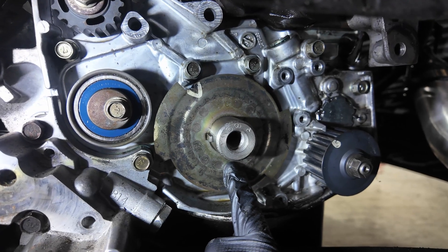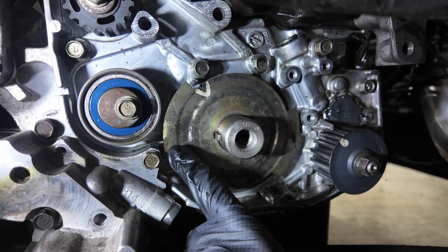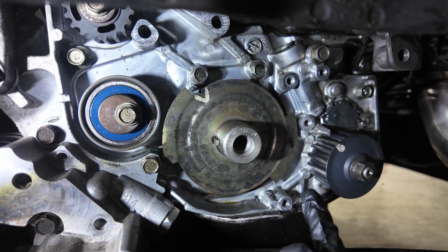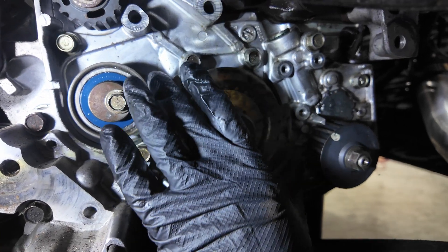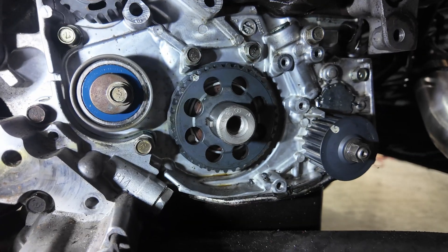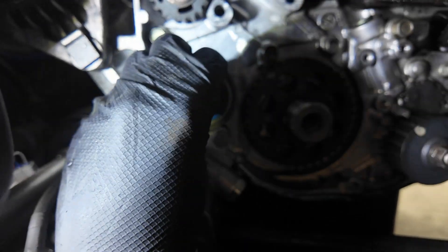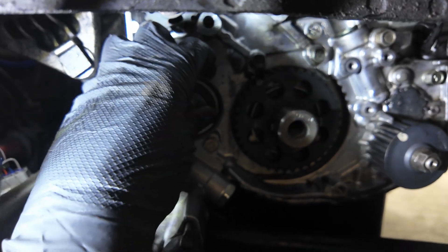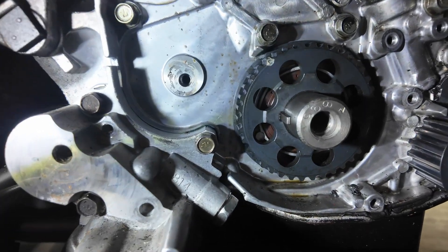This gold part here is the Evo's factory crank angle sensor, and it's got these two wings on it — those are the only two points it uses for measurement. So we're going from two teeth to the new 12-tooth setup. This is that balance shaft pulley I was talking about, and this is the bolt hole that actually has oil behind it, so that's the one you'll need to use thread sealer on.